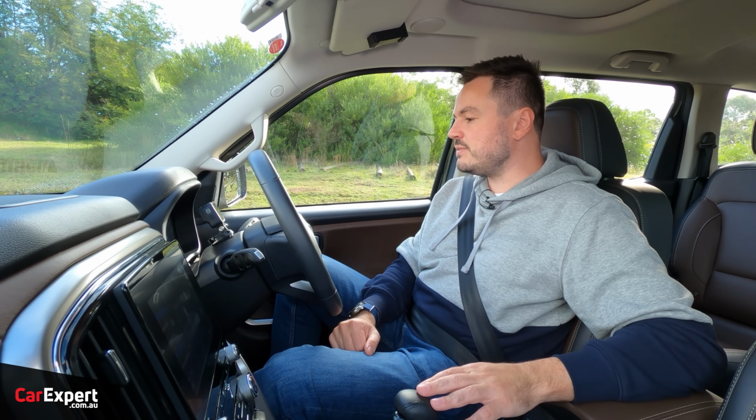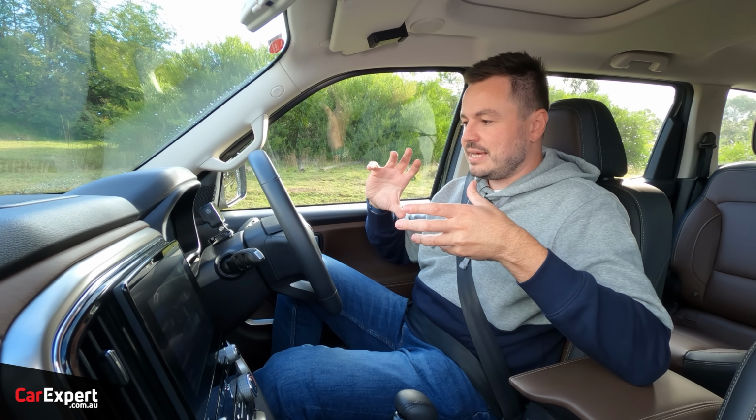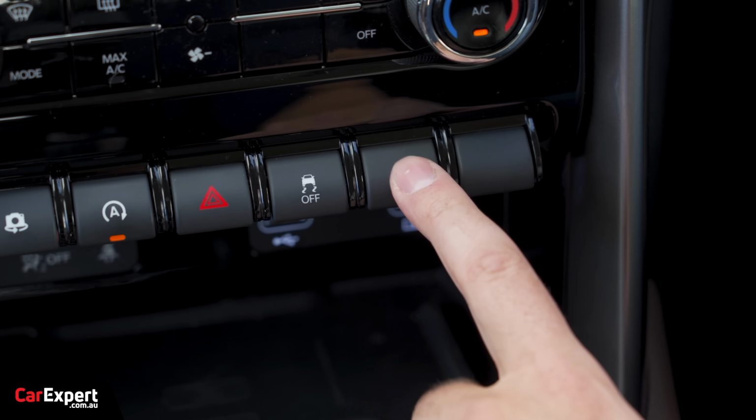This has four-wheel drive high range, four-wheel drive low range, and also 4 different drive modes, plus a mechanical locking rear differential. It is an automatic locking one, so that means that when it does detect delta in tyre speed, it will then lock on its own. I don't love those, but we'll see how this one performs. We also have a hill descent control as well.